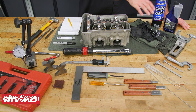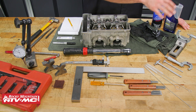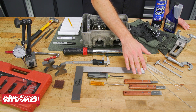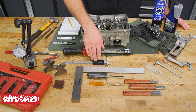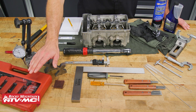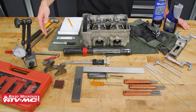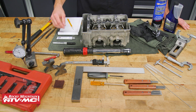To do this job, we have some safety glasses, rags, rubber gloves. We're going to need contact cleaner — the Polaris manual wants us to use this carbon clean. We have some micrometers and snap gauges, pipe cleaners, gasket scrapers, screwdrivers, a straight edge, digital calipers, a torque wrench, V-blocks and a dial indicator. You'll also need a valve spring compressor — this one's from Tusk. We've got a magnet, a couple of punches, a hammer, and a notepad to write down all of our measurements.